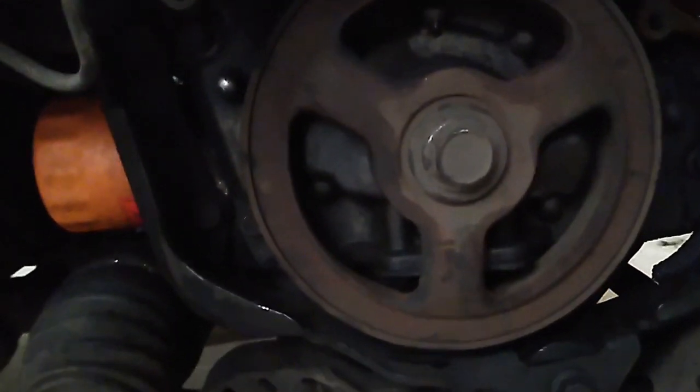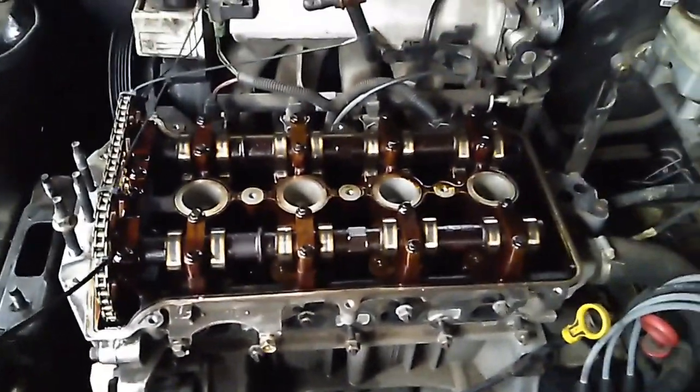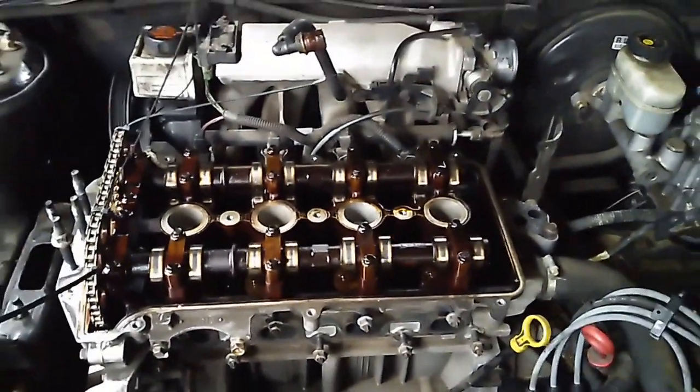As we've reached the done part for the day, that big cog comes off and then the timing cover bolts come off. Once the timing cover bolts come off, then I can depressurize the fuel system, remove the upper radiator hose from the unit. There might be some little things to unplug over here and some bolts, but basically for the most part this is stripped down enough that I should have this head off relatively quickly after all this.